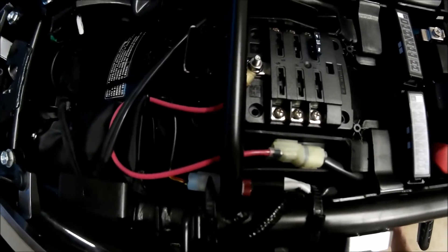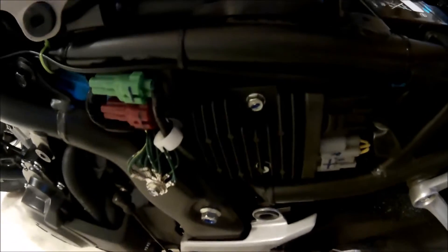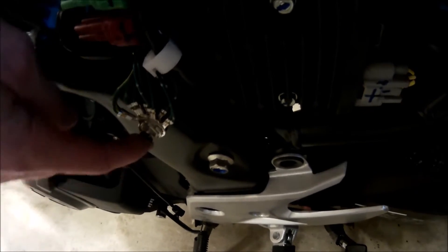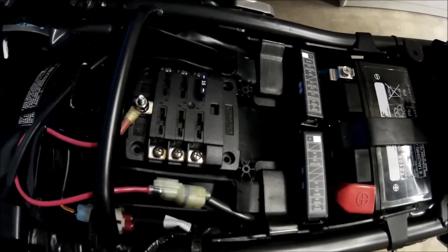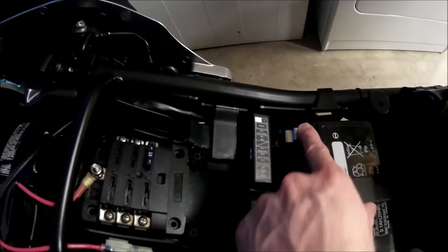I'm not sure where I'm going to find a ground wire yet. If you remove the side fairing off the bike, one of the frame grounds is right here, but it looks pretty well used — I was thinking about using it but I don't think I will. I may run a ground wire off just the negative terminal of the battery. I don't see another really good source for ground underneath the seat, so that may be my best option — just to run right off the battery.